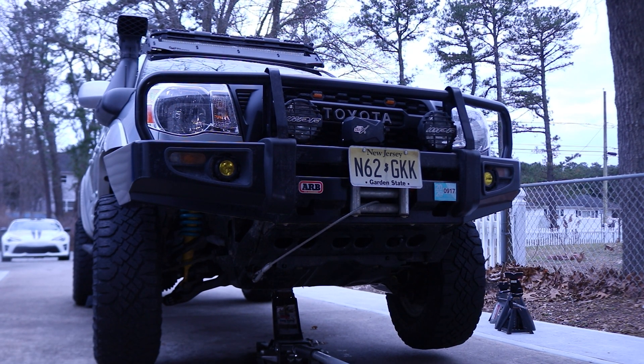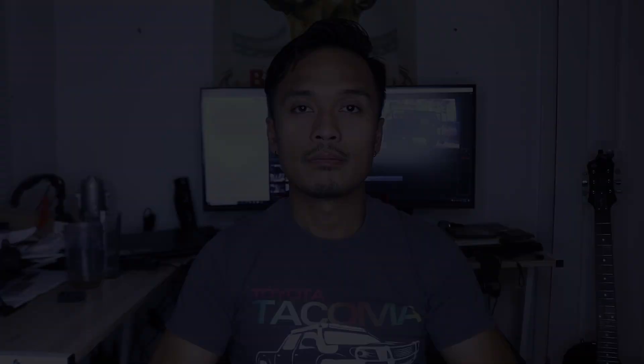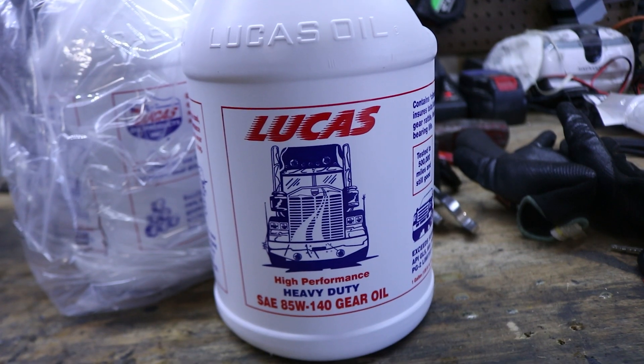Last but not least, we'll jack down the truck. That's pretty much it for the installation portion. You will have to fill up the front and rear diff with the proper lubricant — I won't be going over the details of that because I've already made videos on it, so check those out on this channel. I did buy a total of 3 gallons of lubricant for this job because, according to East Coast Gear Supply, you're also supposed to change the lubricant after 500 miles of breaking in these new gears.